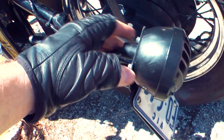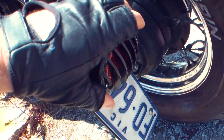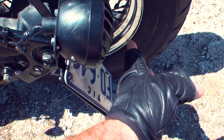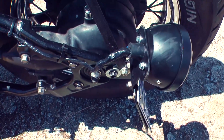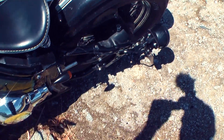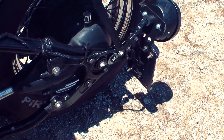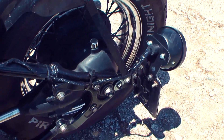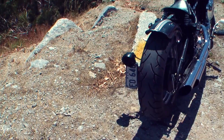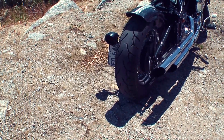I've got the side mount plate — that's your stoplight, which is also from Bad Boy Bobbers, and it looks quite good. I've had a bit of a spill with this. It was hitting back about here — had an extension bar on the back which snapped and sent it flying down the road. But it's certainly strong enough to take a tumble. We've got the wiring, which is all going to have to change once we extend it back further to make it more legal. It has to be visible from 45 degrees, which is probably a bit of a grey area.